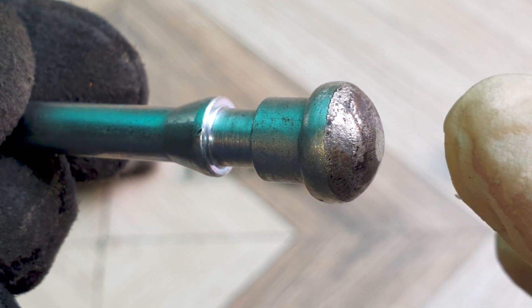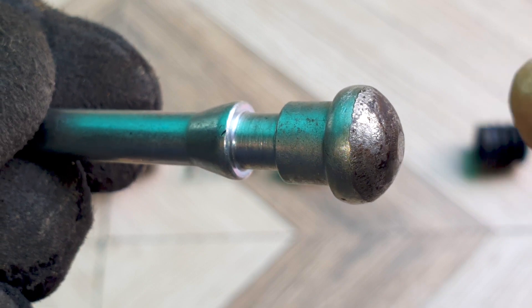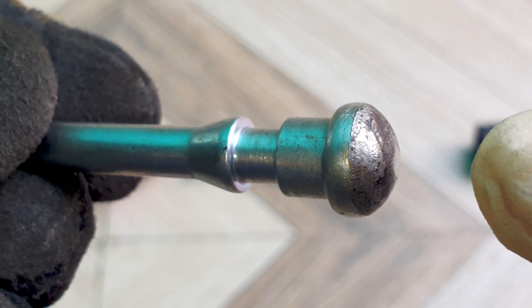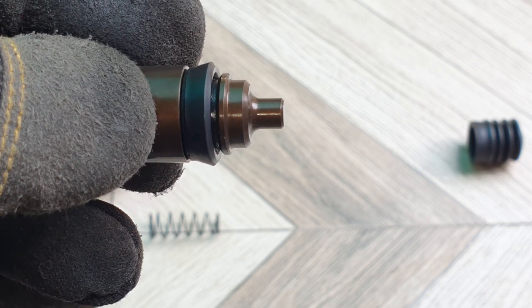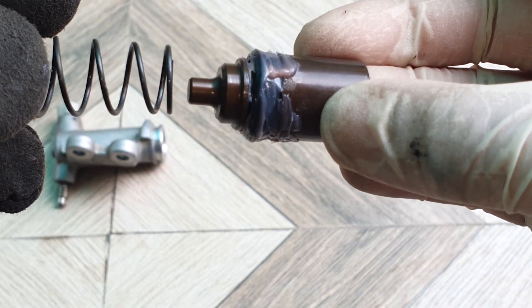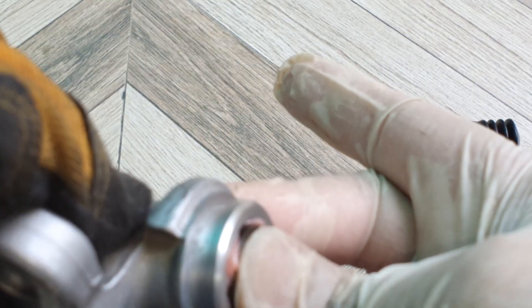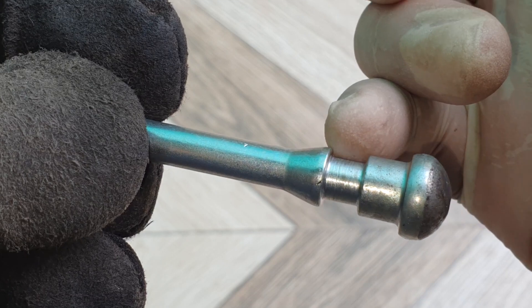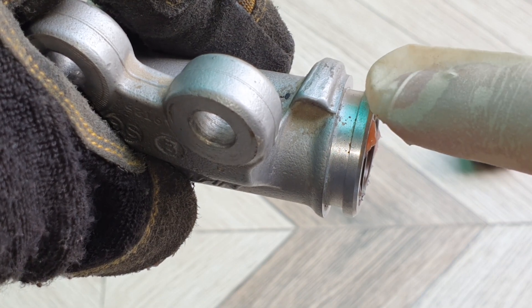So you may hear a rattle when the car is idling — if it's idling there's more gap, this is hitting against the clutch fork. You can replace this rod; the part number will be listed in the description. Honda says to apply rubber grease over here — this is the only seal we have on the slave cylinder. The small end of the spring goes on this piston. On this rod we need to apply rubber grease where the boot rests, and also where the other end of the boot will rest.